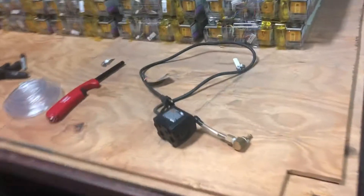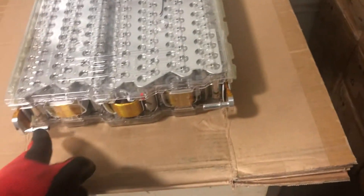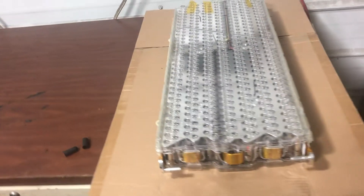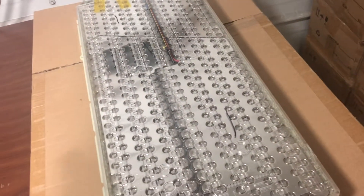What I'm going to do is use an aquarium pump which will get submerged into this distilled water here. There's a quarter-inch inner diameter tube that goes over top of this nipple, and the other end goes into this inlet to circulate through. I'll have another tube that comes out of this inlet going back down to the water source. Once water starts flowing out and I see it returning to the water source, I'm going to pinch the other end with my finger, deadhead it for a minute, and let it build up pressure.